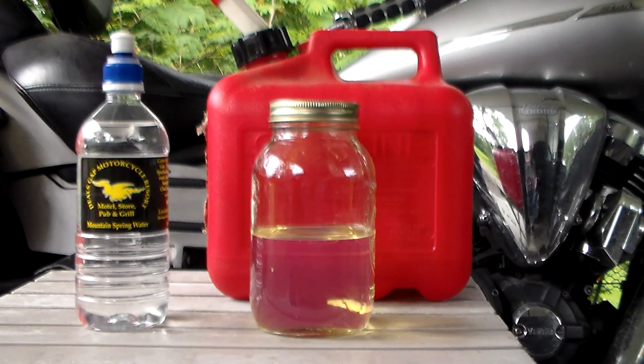Some gas stations are starting to carry it, but they also offer synthetic fuels now — we used to call it white gas, similar to Coleman stove fluid. Several companies make a product like this: one makes it with ultra-pure gasoline with lubricants, another — associated with the chainsaw industry — makes it completely synthetic with no ethanol. Their synthetic fuel is guaranteed for two years. It can sit in your motorcycle, chainsaw, or lawnmower for two years and they guarantee it will not cause corrosion and will protect everything inside. From my personal experience, I've sold a ton of that stuff and it really works. I keep my chainsaw and blower running on 100% of that blend all the time — I never put anything else in them and they're always ready to go.